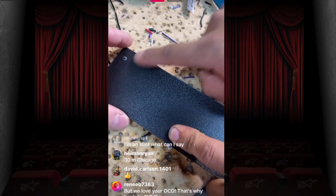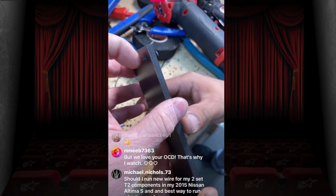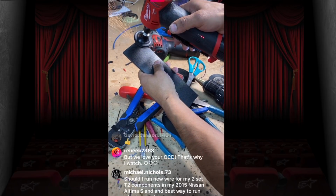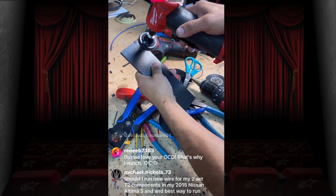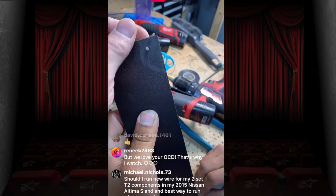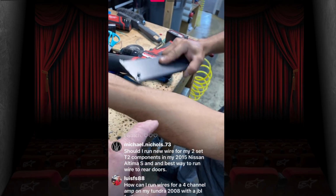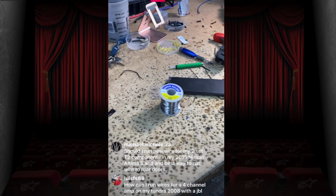So Fernando went ahead and drilled in a screw. So you figure that's going to have an amp rack. We got a little pointy tip right there. Use your glasses, people. Yeah, I have mine on. And there you go. So now it's perfectly flat. Anytime anything's going to go underneath the hood of a car, that gets sanded perfectly flat just in case someone's reaching through. We don't need a sharp point to hurt your day or poke into a battery or a wire or anything like that.